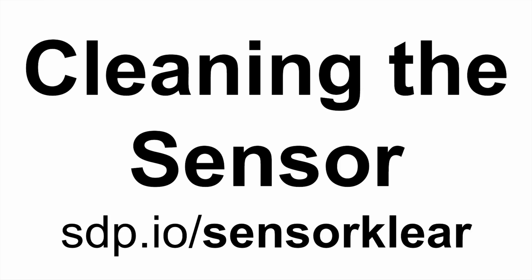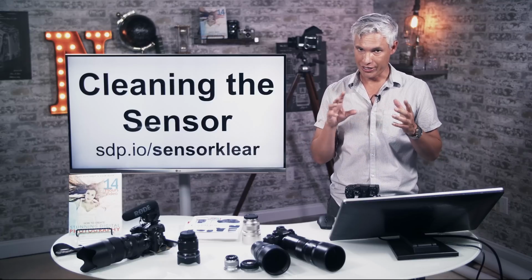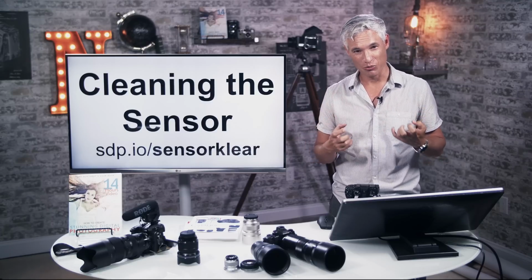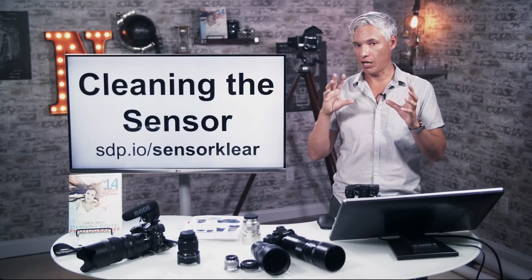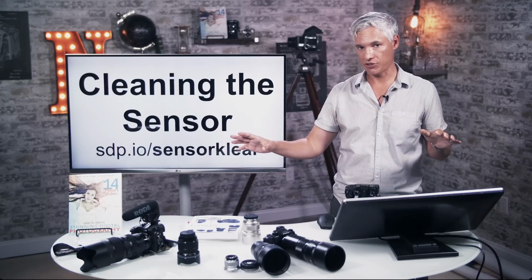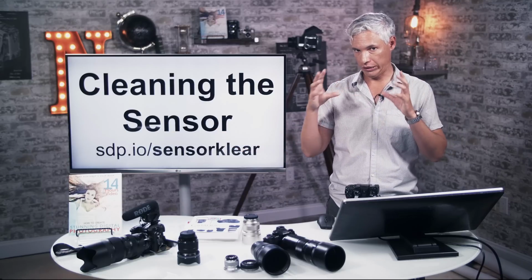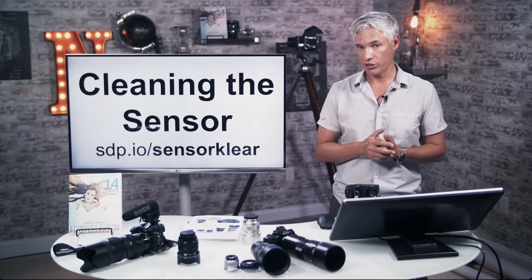You might end up getting dust on the sensor. The camera will automatically clean the sensor by shaking it some, but sometimes you get just dust that really wants to stay on there. And that will show up as just kind of blobs in your picture, especially in empty parts of the frame. Like if you take a picture of the sky or an empty wall, you'll see little blobs. It's just dust on your sensor. You don't have to send your camera in to be serviced.